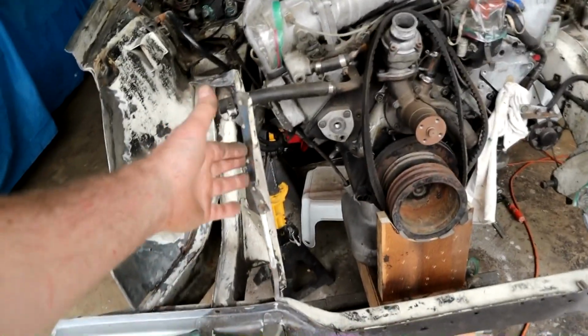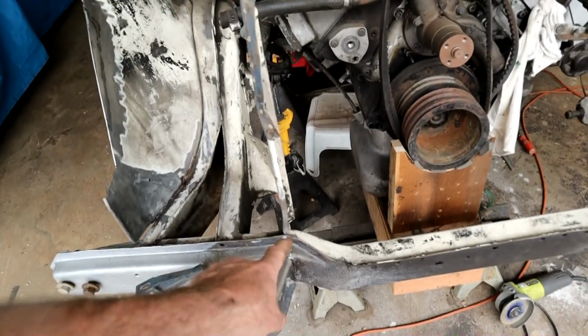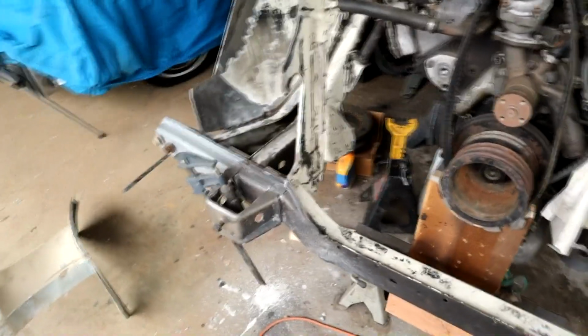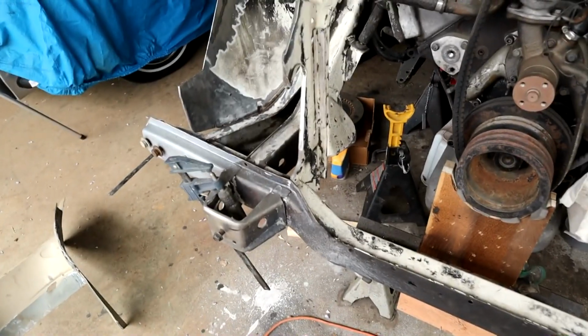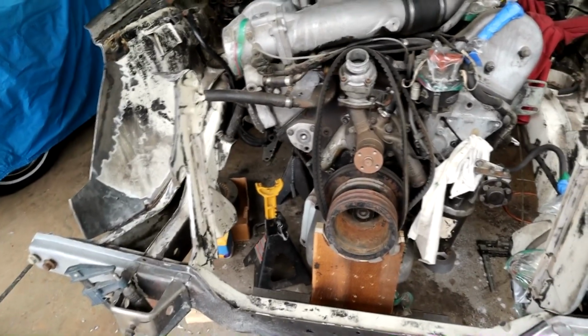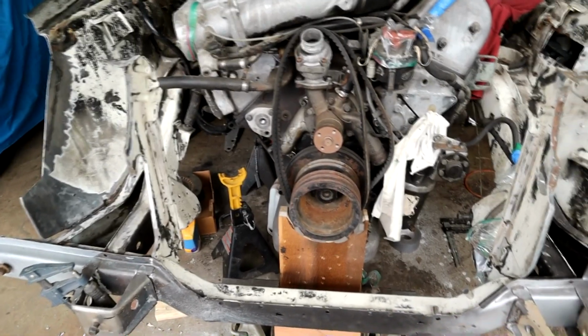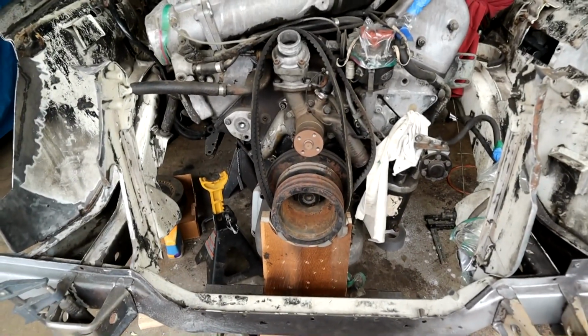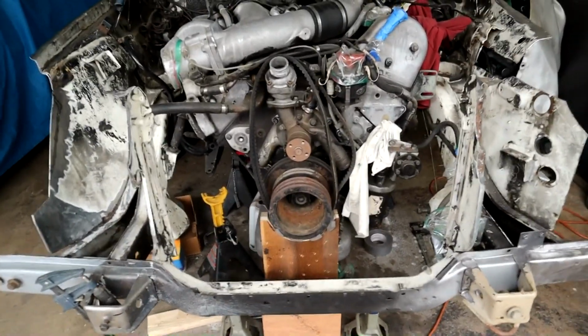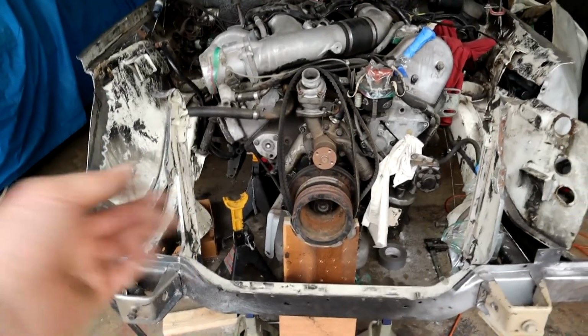These stanchions, obviously the radiator holders, I left because I didn't want to get into breaking the spot welds down on the bumper bar, because when you're breaking those spot welds you can damage the metal behind. So I wanted to limit that, and also the measurement between these two stanchions is slightly wider, probably about 3/16 wider than the donor car. Now I think that's probably not an error but a change in the factory. They didn't quite line up, because I think the distance there isn't vital to that degree, within the 16th, but I left them just in case.